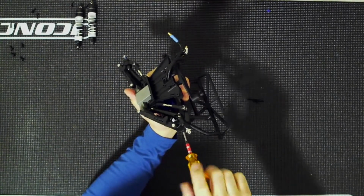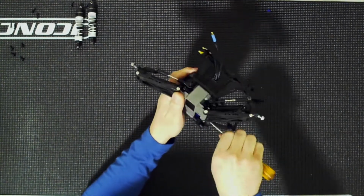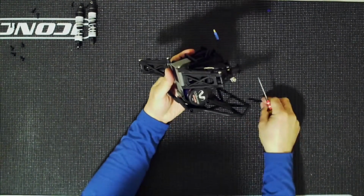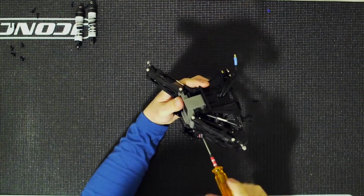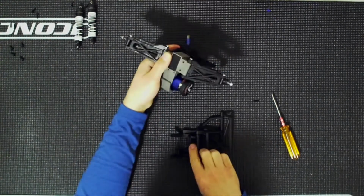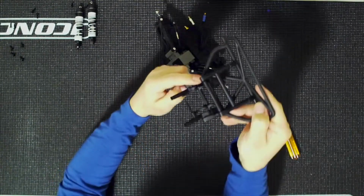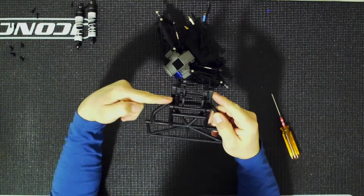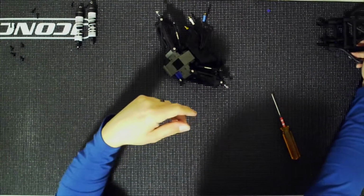Now, when you're setting things aside, one of the things that I like doing is the following. If you recall, the long screw came here. So I'm actually just going to set that screw there once I remove the button. Actually, I'll place it there now. And this one's out. All right. There we go. So I'll just leave the screws in the corresponding slots. That way I know where they go. So again, short screw, well, if you're looking at rear or front, short screw goes on the right, medium screw goes top left, long screw goes bottom left. And that's the bumper.